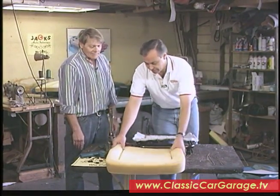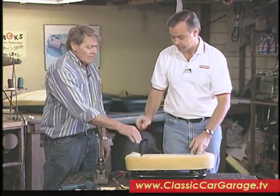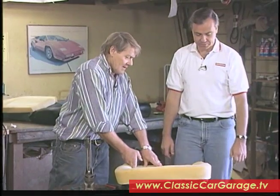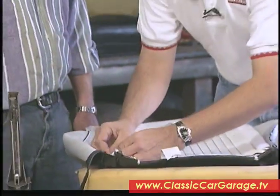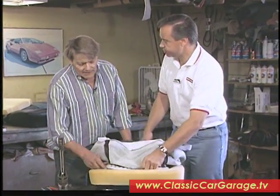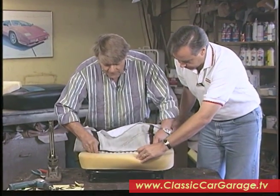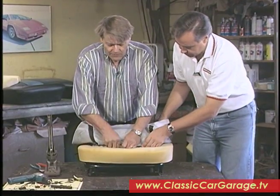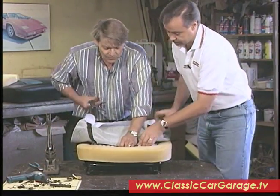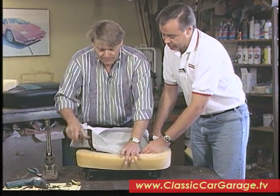Now that you've got all these hog rings on, it's time to put the seat bun on. This seat bun should fit pretty well, and the only thing that holds it down is going to be the upholstery — just hog ring it on and it holds it right in place. Then we'll put the wires in and start hog-ringing around this horseshoe. Our wire is down in our listing. The next step is to attach this wire down to the seat bun — you get it centered down in the groove, then hog-ring the wire down to the horseshoe wire underneath, going through the foam pad and catching that wire. It takes a little practice to feel the wire, but after a while it becomes a lot easier.